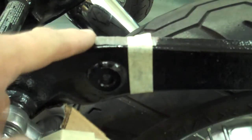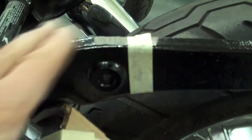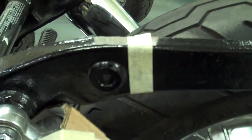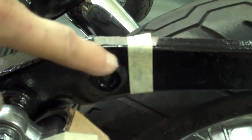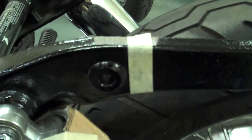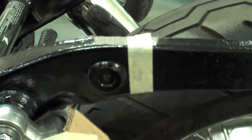I finished cutting that off — it just took a minute. Make sure this is a little bit below the surface or just flush, because once we put our sheet metal over the top we don't want that to stick up there. You can always grind that a little bit later. I've put a piece of tape here about even with where the little radius of this flange blends into the flat area of the strut. I'm going to cut straight down there, perpendicular to the ground.